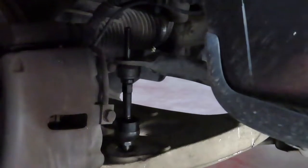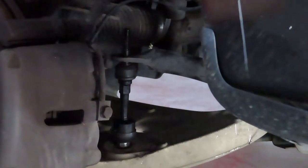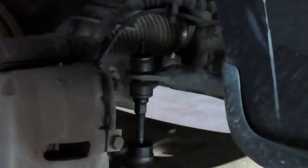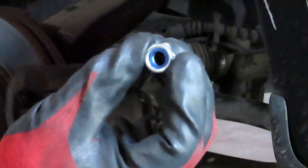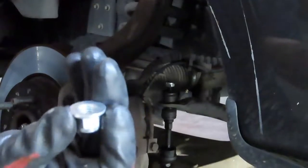We're going to use the rubber mallet to tap it in. Then we're going to put the bushing in on top of the sway bar and put the nut on top. This is a lock nut — you can see the rubber Loctite inside, so once you get it tightened it's going to lock tight itself. Then you get the larger nut, which also has Loctite — you can see the white — and that goes from the bottom.